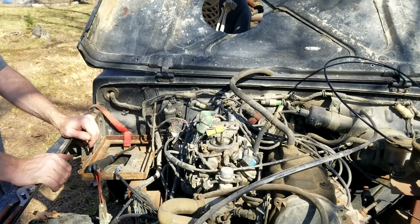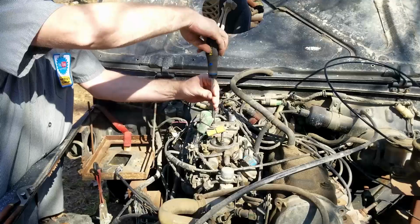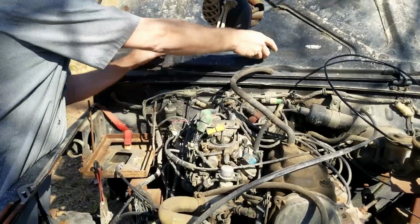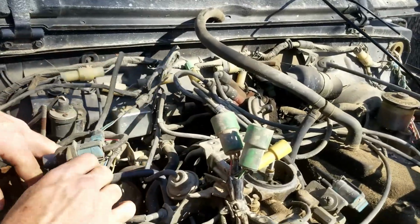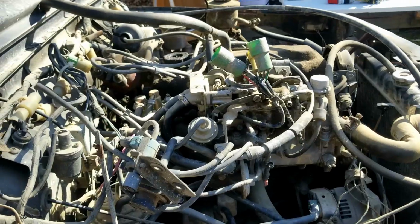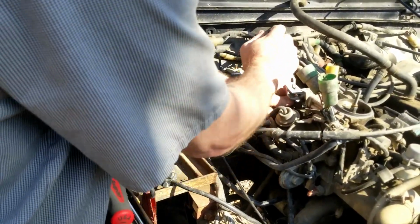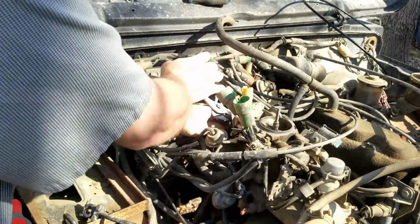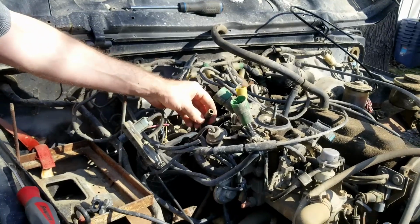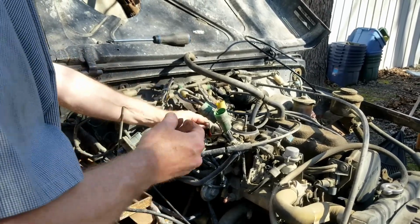Next, when removing the water hose from the stock choke, beware the coolant might spill out. Have a 5/16 bolt handy to plug the hose to prevent excess coolant loss. There's your hoses. Yeah, flat screw. If you got a stubborn hose, use a pair of pliers. Grip it, but don't squeeze it too tight as to bend any of the fittings. But in this case, that carburetor is going to be exchanged out, so it wouldn't matter.